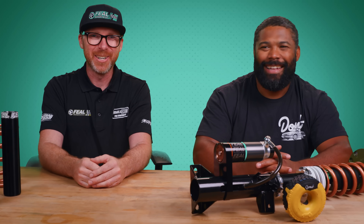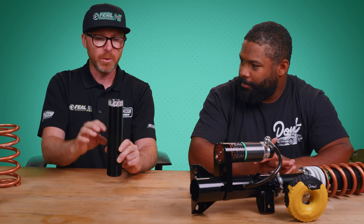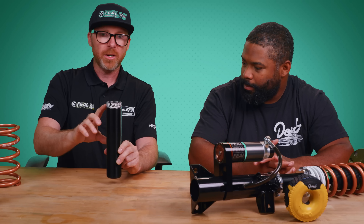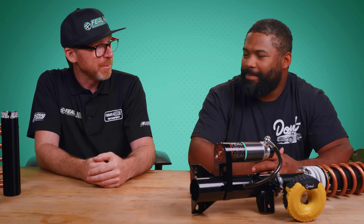As strong as inverted shocks are, I hate them because they're a nightmare. As the shock drives in and out, this tube with the two bushings is just grease — it's a very barbaric system because the grease is the only thing lubricating these two bushings. The bushings have Teflon on them that wears off, the grease wears down, then you get a lot of friction. Very high maintenance.